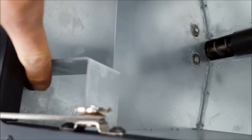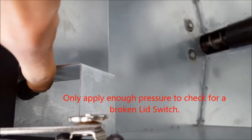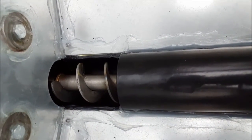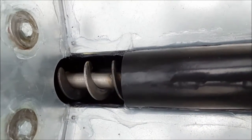Opening the hopper lid, we're going to locate our lid switch. If you push down, you should be able to check for any broken lid switch or push in to test the functionality. Next, we're going to press the prime button and the lid switch — you should see or hear any auger rotation. Keep in mind this is a pinch point, so keep your fingers clear.